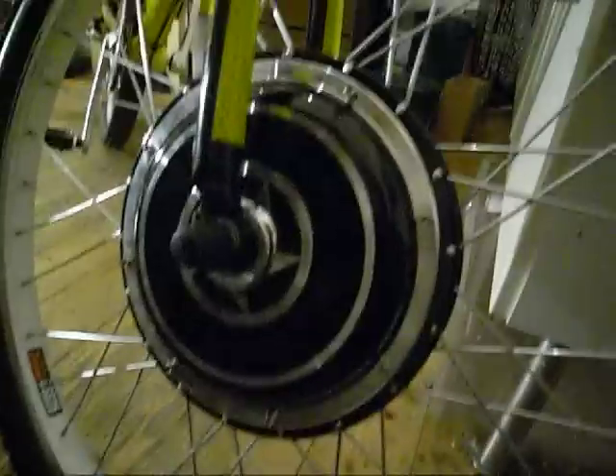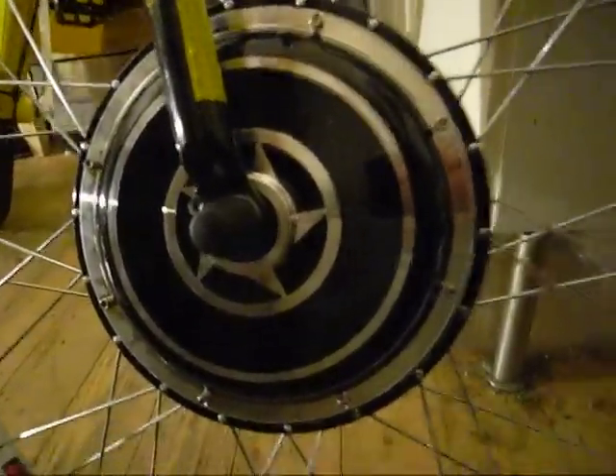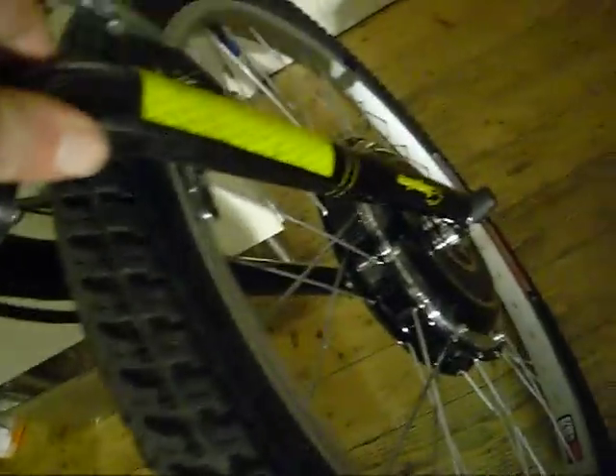A really important part of this is the front wheel that came with the kit — there's a 1000 watt brushless hub motor built into a 26-inch wheel; you get the whole wheel. You can see the cable coming out of the wheel there, running right back to the controller. I've got steel chromoly forks rather than alloy, which makes for a much better grip. I've heard of a lot of people with alloy forks having the lugs stripped out because of the power of the wheel — it's quite surprising how fast it is.